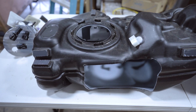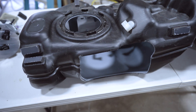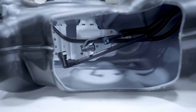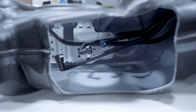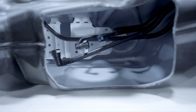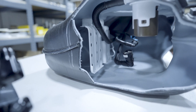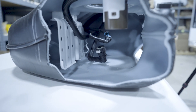This is the fuel tank for the CTSV. The ATSV is very similar. The Camaro is also similar but a little more simplified since it doesn't have the baffling. We've sectioned it away so we can demonstrate what's going on during the installation. There are four lines inside the tank. One is connected to a valve on the left-hand side — don't worry about that. The three unconnected lines are what we're concerned with. The bottom-most large line is the tank vent, and the two upper lines are for the fuel transfer system — one on the left is the Venturi jet discharge, and the one on the right is the feed. The baffle system encroaches on where the pump module is going to sit, so the orientation and sequence of these lines must be respected.